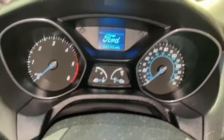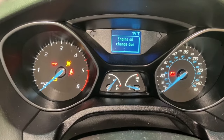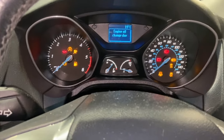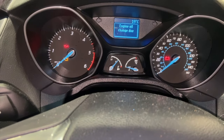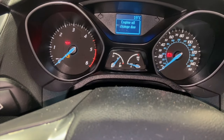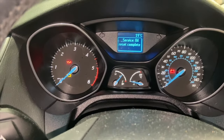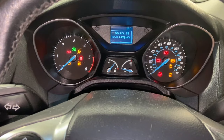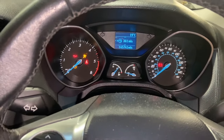That's a pretty standard procedure on a Ford for the service light reset. If you put the ignition on, you can see we've got the engine oil change due there. Straightforward reset: start with the key off, put your foot on the accelerator and the brake — keep them both depressed — turn the ignition on to stage 2, keep the pedals depressed. It does take a little while, then you'll get a little message saying oil reset complete. Release the pedals, turn the ignition off and back on again. You'll see the reset message there — do it again and that will all have disappeared.